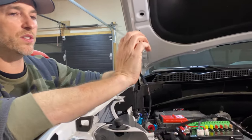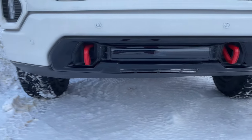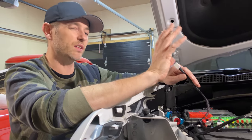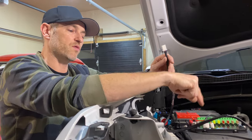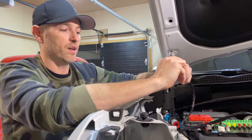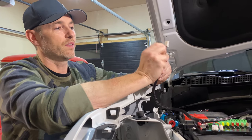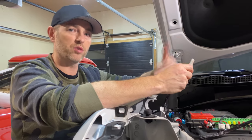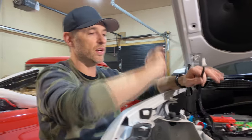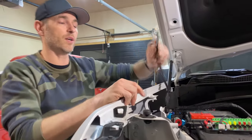Now for the light bar — because it was a light bar I knew would fit but not exactly what I really wanted, I'm going to leave all the relays intact and not chop up the harness. I'm just going to use the Auxbeam as a switch for the spot lamp under switch one and the daytime running light on switch two. I can actually group them together so when I push one button, both come on, and do all different variations. I'll just cut this one plug, leaving enough space to resolder if I put it in another vehicle or sell it. For any accessories — light bar, roof lights, ditch lights, underglow — you can hook up positive and negative directly here without worrying about relays since they're built in.